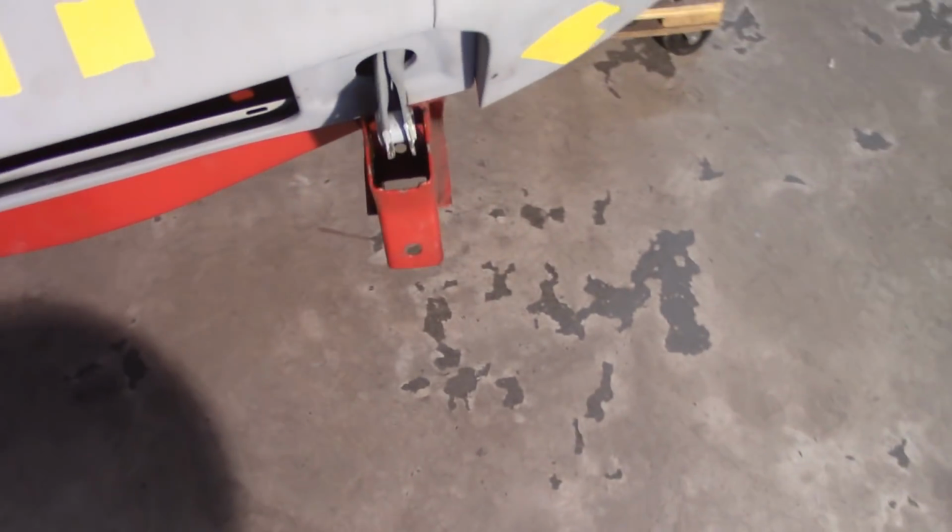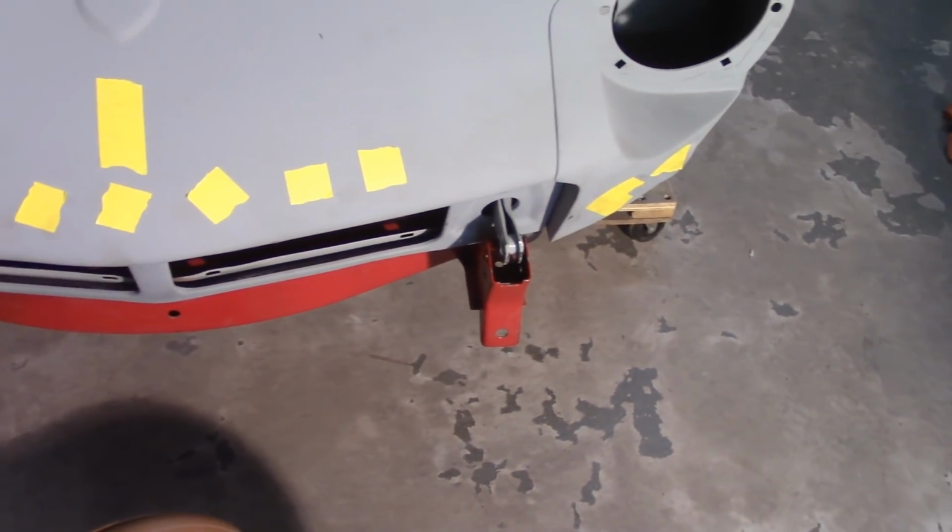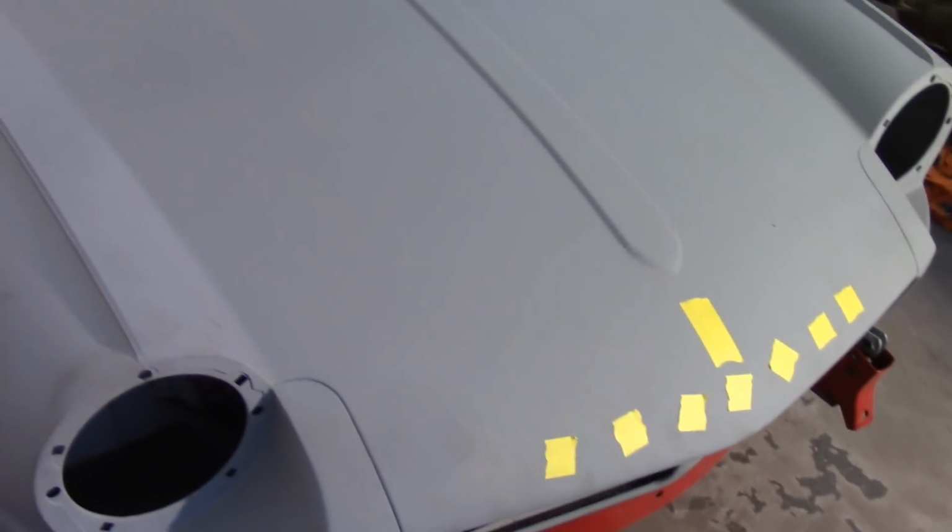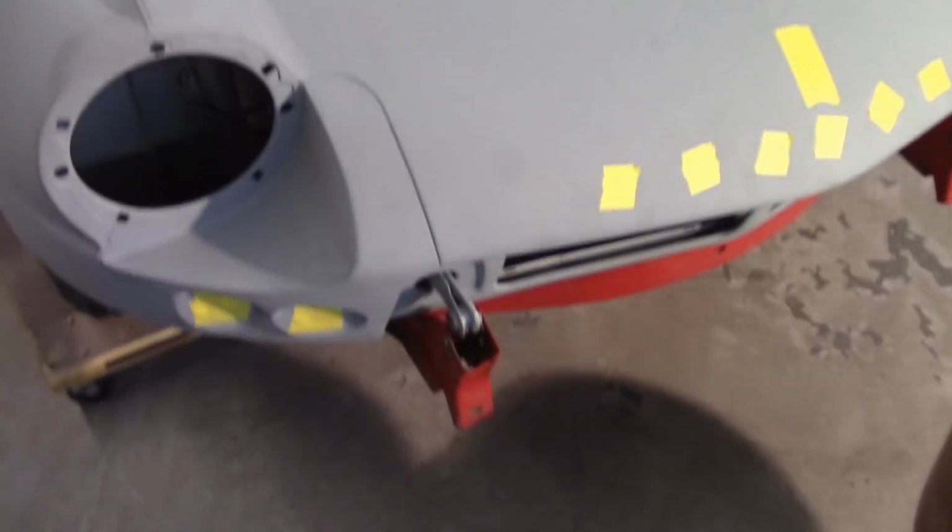Not perfect, but it's better. So that one's over, not much, 1/16 of an inch or so. That guy, I kind of spread him out a little bit too, so they both tend to move to the outside at least. So squeezing them both in, hopefully will kind of cancel each other out. As a reference point to try to make sure that the bonnet was centered, and then adjust those pivot tubes off the center to try and center them in the brackets as best I could, I used that hole down there in the cross member and the center of the bonnet.